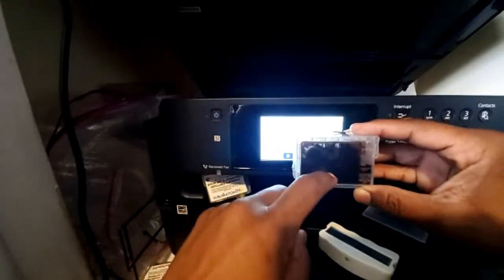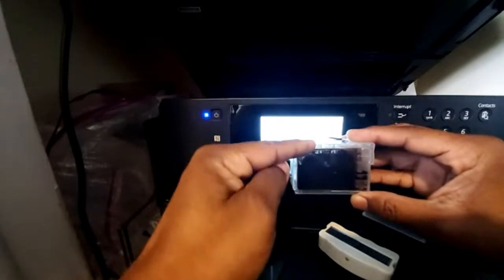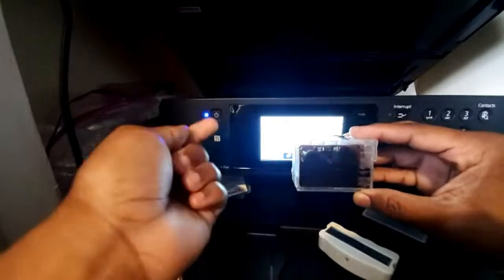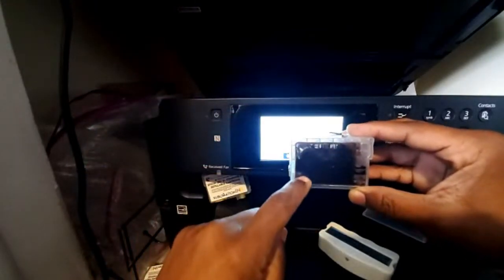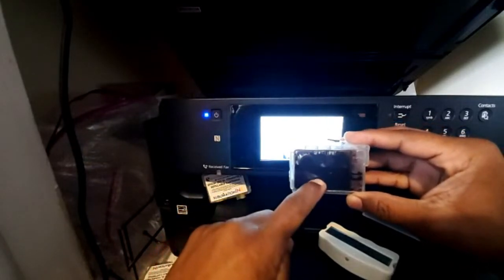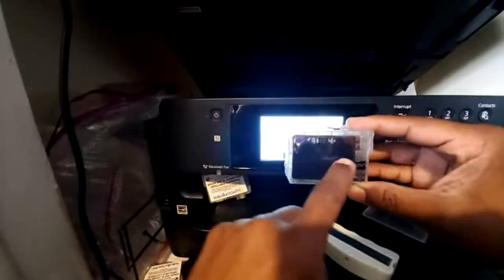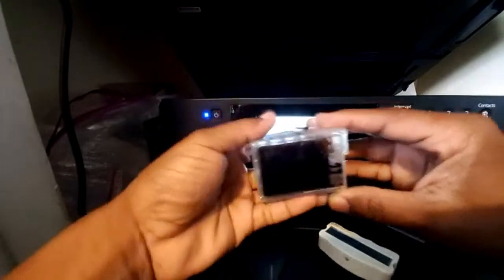The only time it goes out, let's say like right now, I reprimed it. I reset it, but I didn't refill it. Maybe the next time, all the ink will be gone. And I also don't print on premium matte. If you use premium matte, you're going to use up a lot of ink, and yours may end up being empty to the bottom. I print on plain paper settings. So by the time it tells me it's out, I still have all this ink down here, and there's still some in the top chamber.